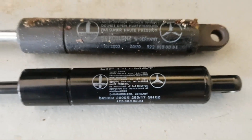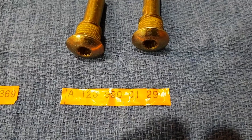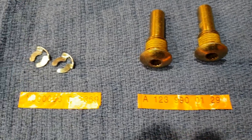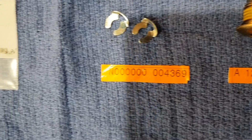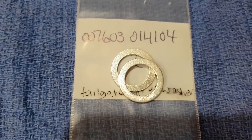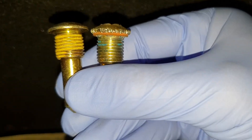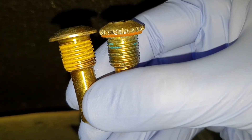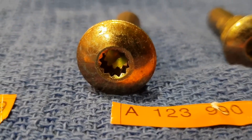Here are the new and old struts — the old strut looking like it was from 1979 and the new strut made just last year. There are several new parts which also need to be purchased, including the bolts, the little circlips with associated part numbers, and the crush washers for the bolts. Interestingly, the bolts are no longer Allen bolts but actually spline pattern, and for this I found you need an M8-style ratchet attachment.